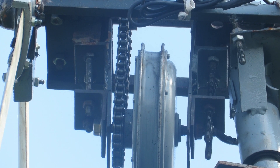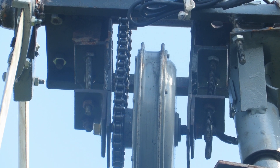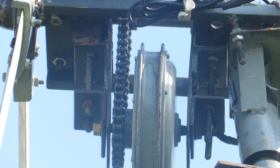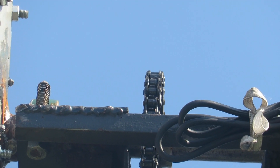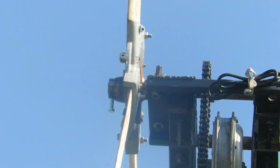In the middle there you can see the electric bike hub, which is a 48 volt one kilowatt, and has a 26 tooth simplex gear sprocket connected to it via the six screw holes where you would put a disc brake — because this is a front wheel electric motor. And there you can see the chain poking out the top of the drive shaft, which has a 28 tooth simplex gear sprocket on it.